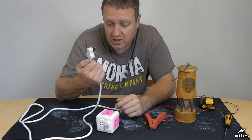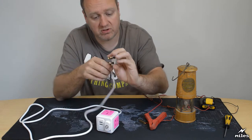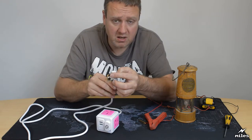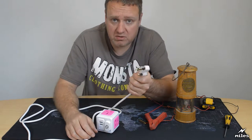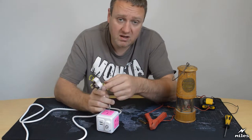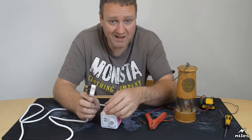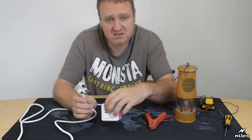But you can't do that with a UK plug because the fuse is on the other side of the plug. So supposing you could turn it around, and you can't, it's designed so you can't do that deliberately, but if you did reverse it, the fuse will be on the neutral side, and that doesn't help you so much, because if you develop a serious fault within the device and it takes a huge current and blows the fuse, okay, the fuse is blown, you think the device is safe, but it's not, because the line actually still runs into the appliance. So that danger is still present, and there's live electrics in the device that you now think is safe because the fuse was blown. So the fuse has to go on the line side or the live side. So the fact that they've got it the wrong way around is actually quite a serious fault.